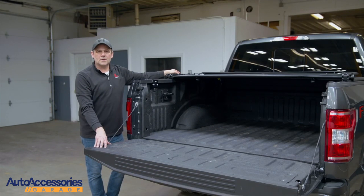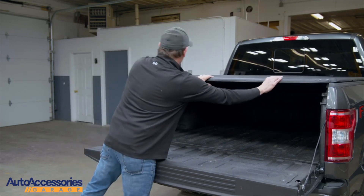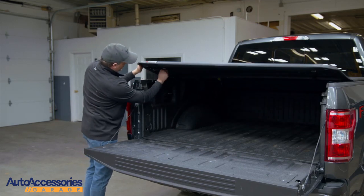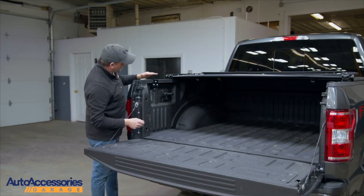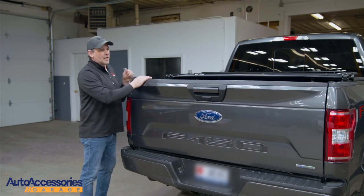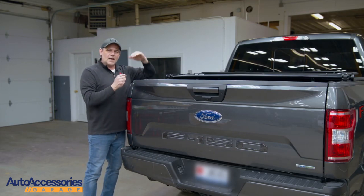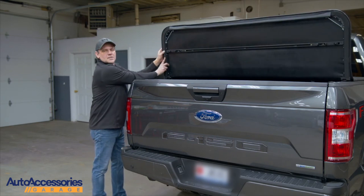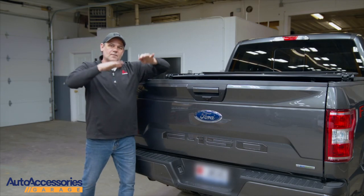After installing your clamps, you want to close your unit to make sure everything latches. If you notice, this side did not latch. Pinch your latch, open it up. What's nice about Leer's clamps is they allow you to make adjustments. Part of the reason is when you close your tailgate at times, it could be off a little bit, or your bed rail caps could have had another unit on it and have impressions in them. Or on our bulb seal, in the wintertime it could freeze, get cold, or have some ice build up. So we're making adjustments to our clamps to give you that fluctuation.